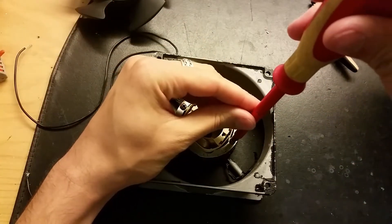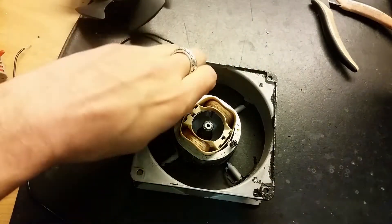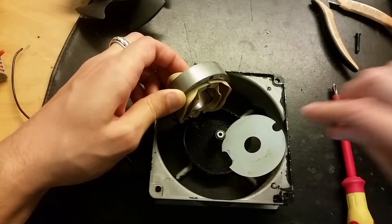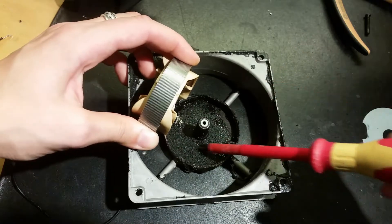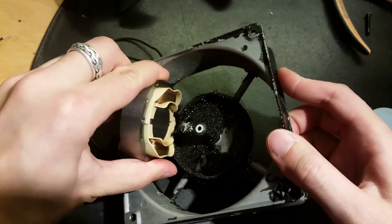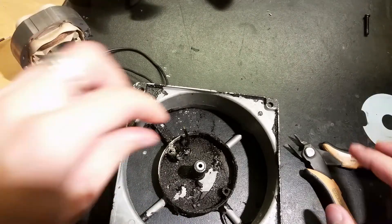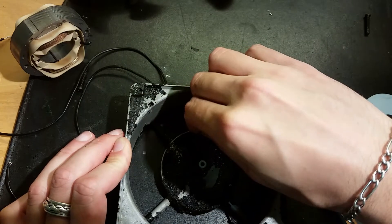Let's remove the fan and unscrew the screws. Let's see if we can find where it shorted out. It even looks worse in here — we need more light. You can see here how corrosive that detergent is: it's completely dissolved the paint. The wires just come off. The actual coil looks quite good. But it actually eats through the plastic — this detergent.